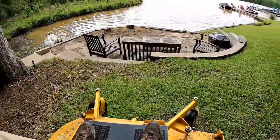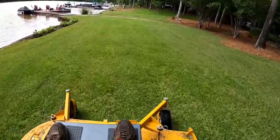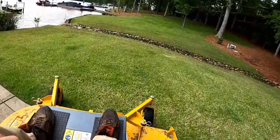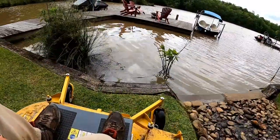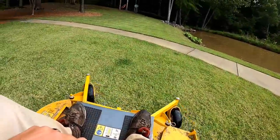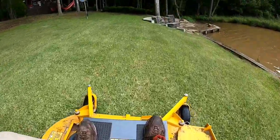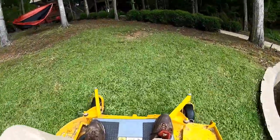So we're looking at 2500 or something with that, plus some weed eaters and stuff in there. And it's a 3500 pound axle, so technically still good on the trailer. As far as weight, you're getting kind of close, because you're getting up to 3,000 pounds probably with the trimmer racks and this and that. But probably not. I'm probably still just under that, a few hundred pounds less than max. So it can work, even on a single axle trailer.